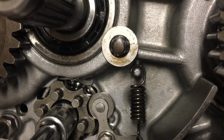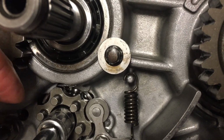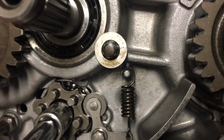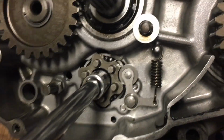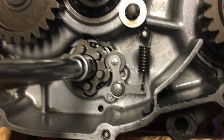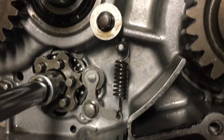And then I zip tied some of the pieces together, and then I dropped the crank in there. So I knew my transmission was good. I didn't want to drop the crank, seal the cases, press fit the bearings on the crank, and then have a transmission problem, because then I'd have to take it all apart again anyway. And you don't want to be pushing that crank in and out and doing all that stuff.